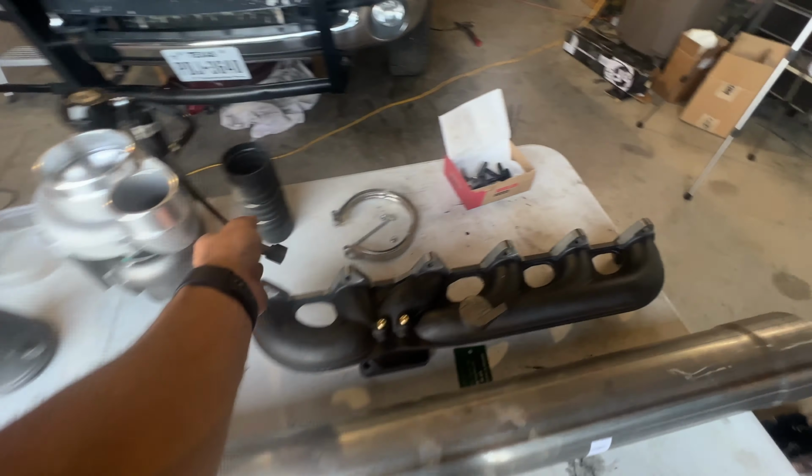All right, so while Lucas and I are down in there, getting some of the exhaust bolted together and installing that delete pipe, I'm going to start installing the studs into the side of the head. In here, you can see we got studs, we got 12 of them, one for top, one for bottom, and then they just thread in. You also hold the exhaust manifold gasket there, and they thread through the gasket and set everything and hold it. Therefore, you can set the manifold on and call it good.